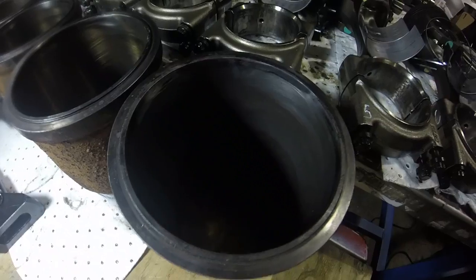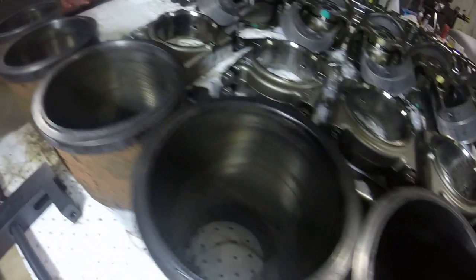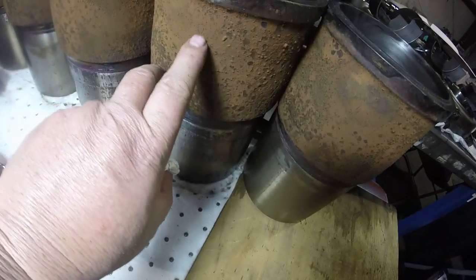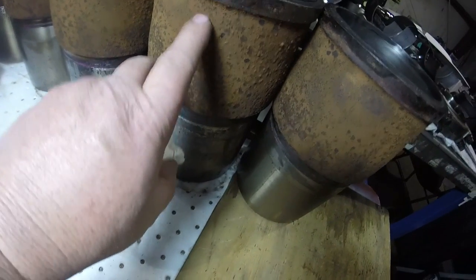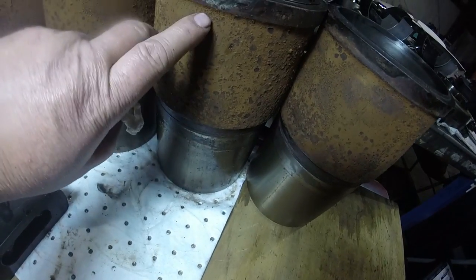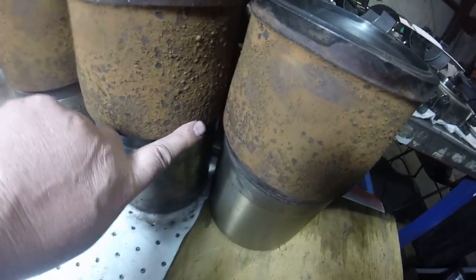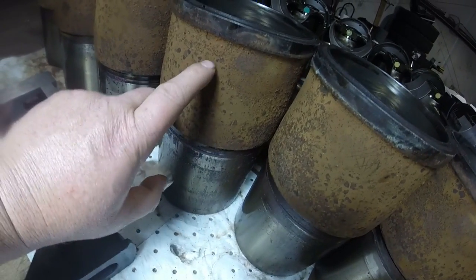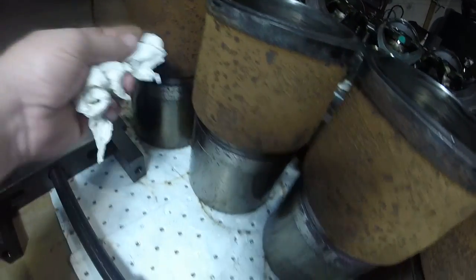This engine would have lasted a lot longer if the head hadn't worn. We do have valve stem wear and a little bit of oil leakage on the valve stems, and of course we had that leaky injector cup. I'm glad I tore the motor down. This is a wax - it's not rust. In the camera it looks like rust but I can feel it; it feels like crayon, really soft like wax. There's some actual pitting on the liners combined with this brown waxy substance.